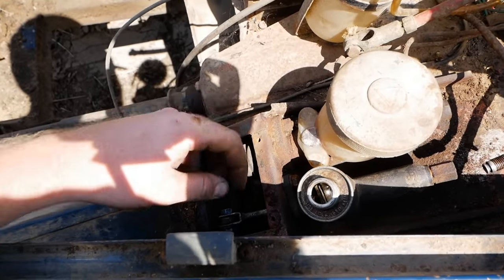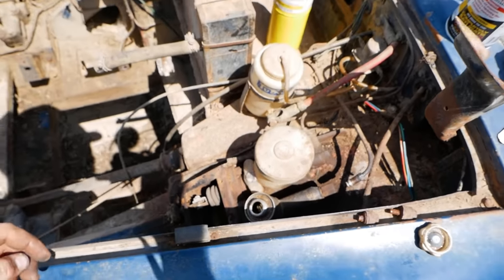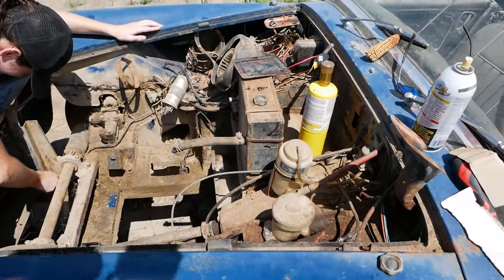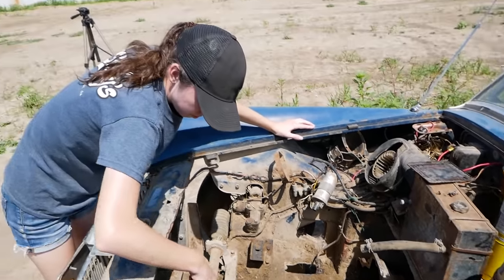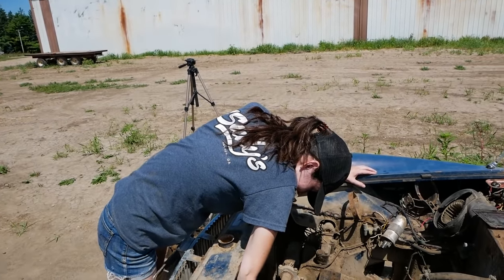In the meantime, I have our new clutch master cylinder in. This is from Steve. Thank you, Steve. He loaned us this. I'm gonna bleed it up here a bit, hook her up, bleed it down there, and then put our slave cylinder on the trans and see if that works. Hopefully, and then we're, probably not. And I think we're ready to put the motor in.